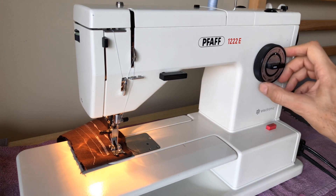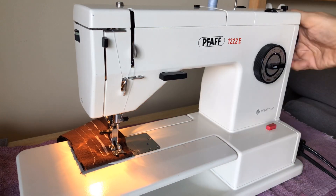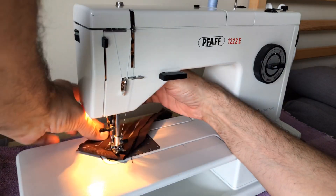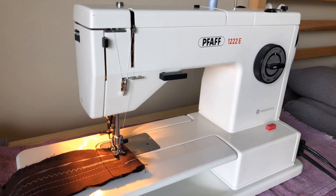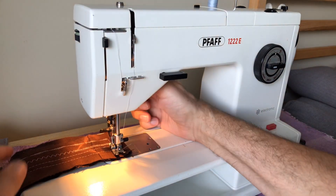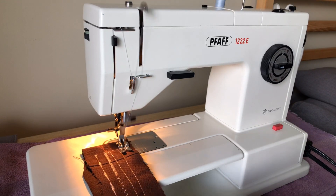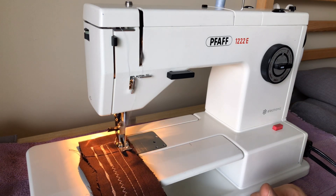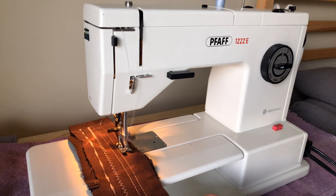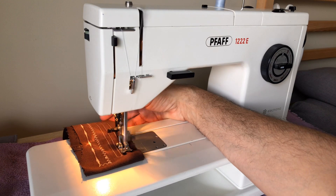Let's go back and I'll show you guys a short straight stitch since we've already got our length fairly low. We'll make one more row. One of the reasons I like doing stitching samples like this — it's nice to have a good-sized fabric with seams so you can always check that the machine is holding tension when the density changes.